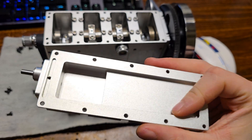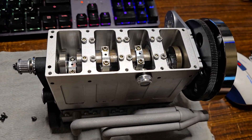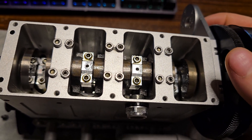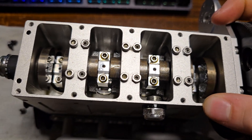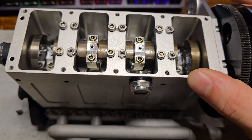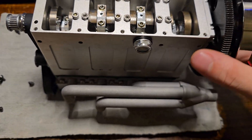No oil filter, but I didn't really see any metal bits in here. It's a three-ring setup — two compression, one oil — and it looks really great in there. I might pop it apart fully, give it a clean, and do some modifications to better the oil return, but it seems to be fine just now.